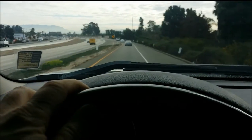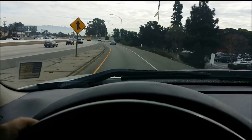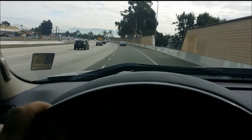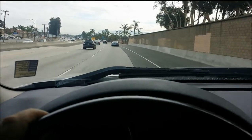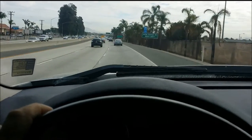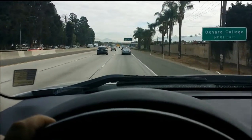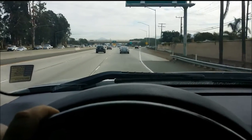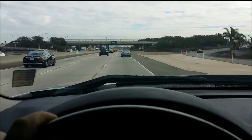And here we are on our test, getting onto the freeway. So far so good — no more noise. That solved our issue. We used the door edge molding because there's glue on the inside, so it sticks to the fins properly. We covered the top and bottom fin, and then a couple fins in on each top and bottom in the centers where we thought the noise was. Turns out this is a great solution and only cost us $20. Thanks for watching our video.